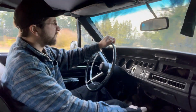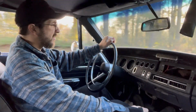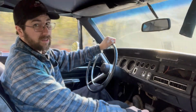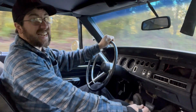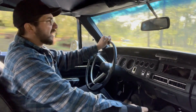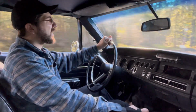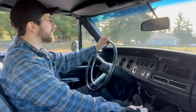Here's the next lesson. This engine is a Magnum 380 horse or whatever Chrysler crate motor. It's got a pretty aggressive cam, and for that reason it really wants a stall converter behind it that's matched to that cam. Doesn't have it. It has a stock converter. It's what we had. And for that reason it's just kind of not happy, especially at low RPM. It makes plenty of power, but you have to get to that point of the rev range where it's making that power. It's not perfect.